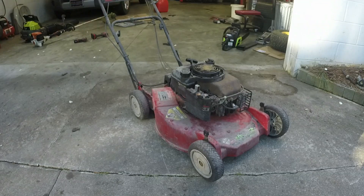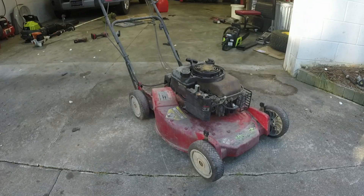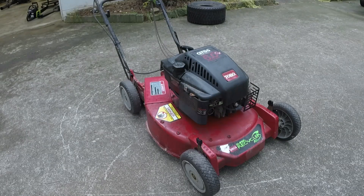I'm going to lube up the cables just a little bit too. I do need to change the throttle cable and move that up over a little bit so that the throttle actually powers down some, as opposed to what it is currently doing. Let's see what it looks like cleaned up. So we have cleaned it up. I ran it for a while, it ran good, and then all of a sudden started surging for some reason.